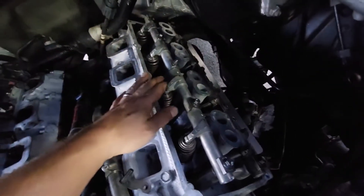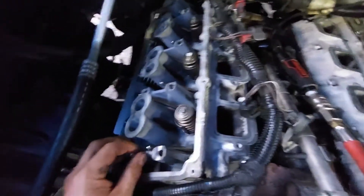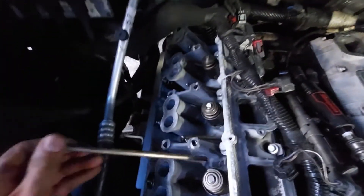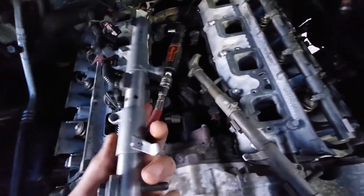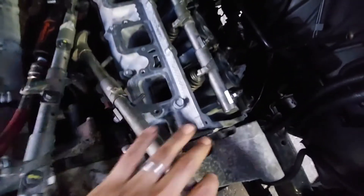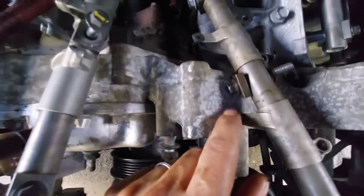I've got the driver's side valve train on. There's a short push rod and a long push rod. The short push rod is for the intake valve train; the long push rod is for the exhaust. Also, the rocker assembly on the intake side has an eye on it so you know it's the intake — the exhaust side doesn't have that marking. I replaced the intake rockers on mine because the pad that contacts the valve was badly pitted on the intake, both on the valve itself and on the rocker arm.